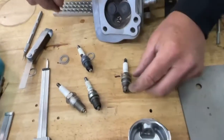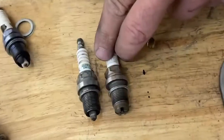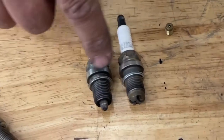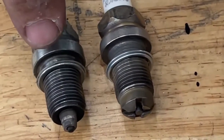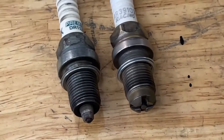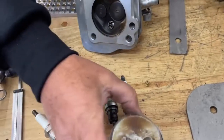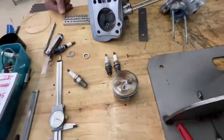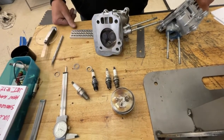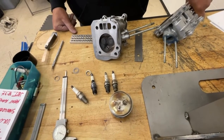So you just have to look for — buy a bunch of spark plugs, look for the deepest one you can find. You can see there are different size washers on them; it's got to be a double-fold washer. The rules don't state how thick that washer is, so try and get that spark plug as deep in the hole as possible. Alright, that wraps up our spark plug video. Thanks for watching — give us a thumbs up from the home of Crybaby Performance, where we try and they cry.